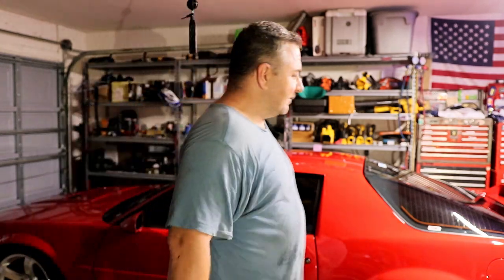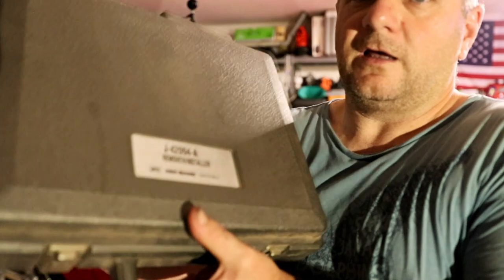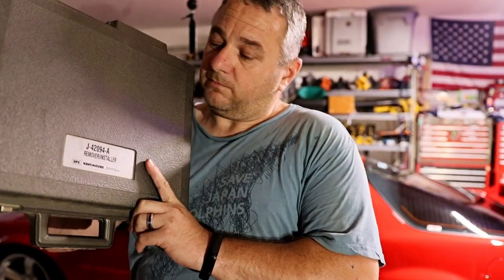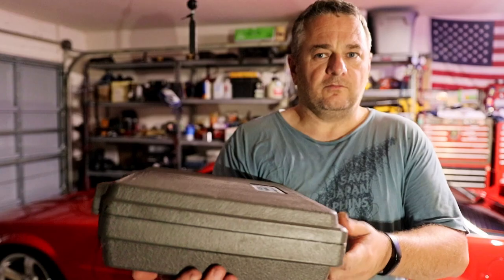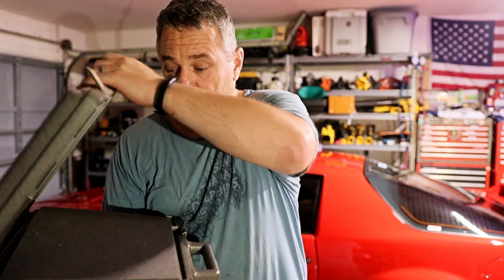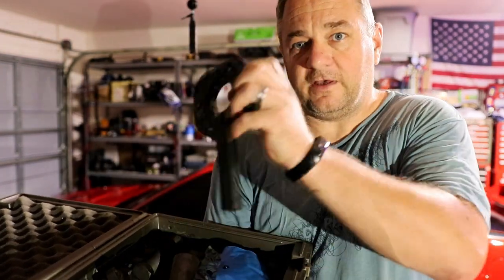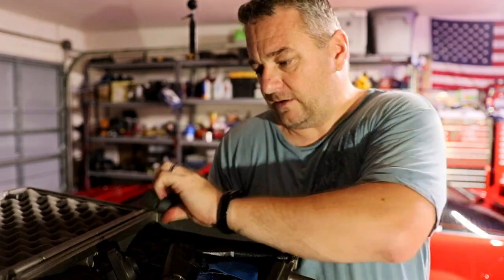There's a good possibility the ECM is programmed for the rear end of the car, or it could still be done through the gears — however many pulses equal 10 miles an hour. I'll get with Smitty, the expert, and find out what I need. Maybe if I've got to pull this whole tail shaft off, we can get KY Chevy down here for another trip. I really hate laying underneath this car, it's getting hard. Anyway, let me show everybody one thing. This is the Kent Moore J42094-A tool kit.